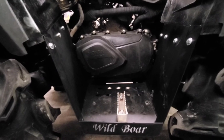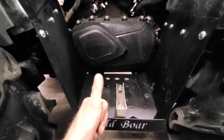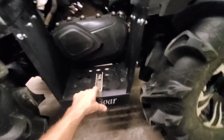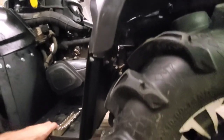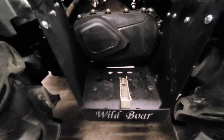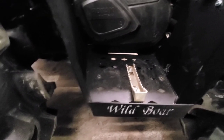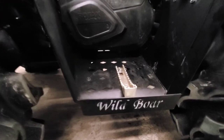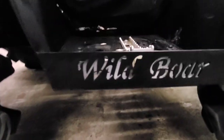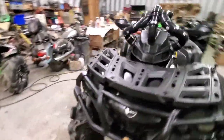This side went on easy. The other ones are missing the plastic part, so I couldn't hook that up anyway. It was missing bolts — couldn't use the OE bolts like the instructions said. No-go on the skid plates unless you modify stuff. I had to tack weld some things for the skid plates to bolt to, and I'll have to cut my skid plate as well. If you're running full belly skids, it'd be nice if they had it set up to accommodate those.